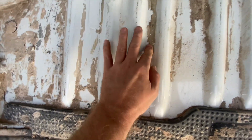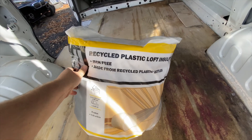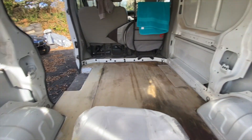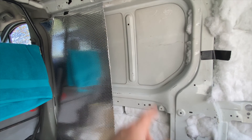Floor looks pretty solid. Still a bit of resin or something on there, but pretty solid. Once everything was ripped out, I decided it was time to insulate the walls, because if I'm going to be staying in here in winter and doing some camping and things, it needs to be warm. I flipped the floor because it was all covered in crap, cut out the doorstep. Now it's time for the recycled plastic bottle loft insulation — good for the environment because it's recycled plastic bottles. I'm going to put that all in here on the ceiling, then put the vapour cover on, and then literally just put the foil on. I still need to insulate up here with the plastic, but I need that to tuck it in behind there because it keeps falling out.